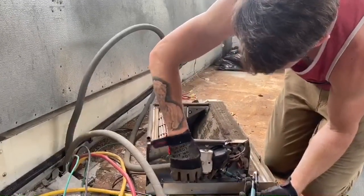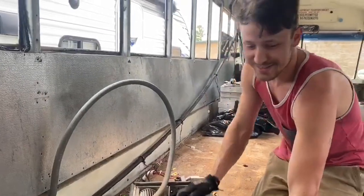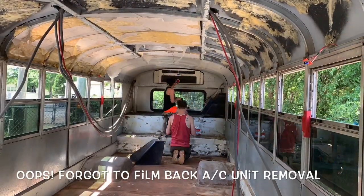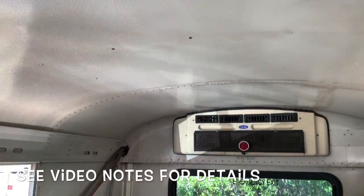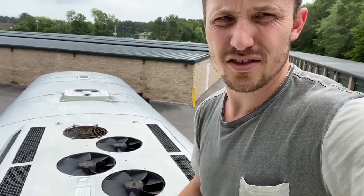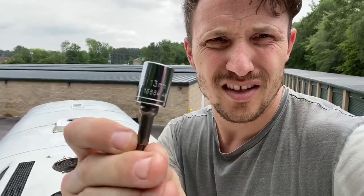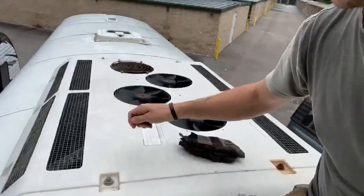If this is how it's going to be for all of them, I feel a lot more comfortable now — this is going to make my life a lot easier. Famous last words — well, let's hope. All right, so today we're going to be taking out this top mount air conditioning unit. I really don't know what I have here, but I'm going to be using a 13 millimeter socket with an impact drill to get these screws undone and hopefully take off this whole top piece.